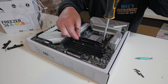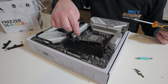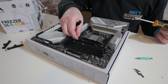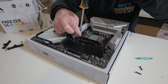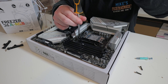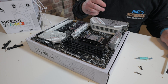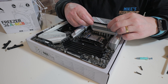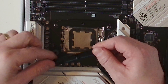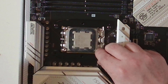You can do this pretty much all the way up. If you loosen it off slightly, it still gives you a little bit of wiggle room so you can slide it around. If you're doing this in a vertical position, you can put that on, hold it in place, and then twist the bracket over. Get your second screw and pop that through the hole, then do this one up firmly. You'll feel a hard stop when it's all the way in. Repeat the same on the other side — you want it spaced wider so it's not covering the processor.